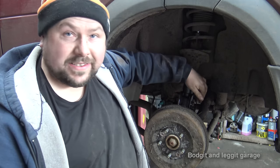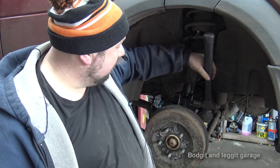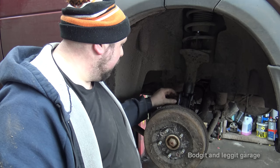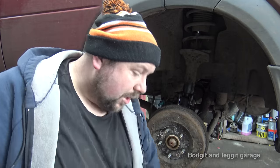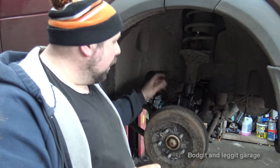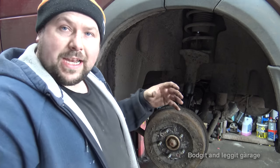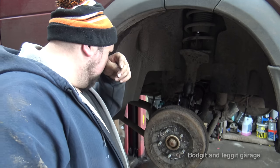And before anyone says, yes, I know there's no nut there, but this is just the weight of the hammer. And it's coming off. This could be hot, so I have to be careful. No, it's not hot. So that's how simple it is. If you've got an air tool as well, an air tool's good. You can always set it down low, and the vibrations help as well. Sometimes with air tools you have to be careful because you can break stuff with them, but if you turn it down low, the vibrations help loosen it as well as turning it at the same time.